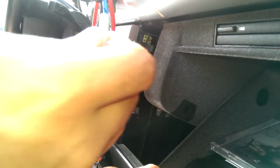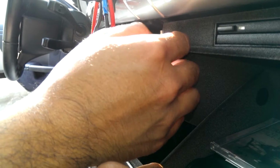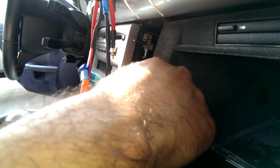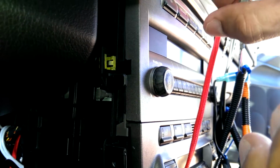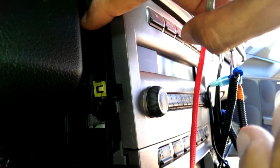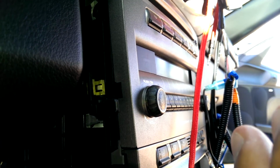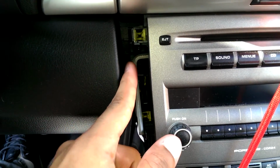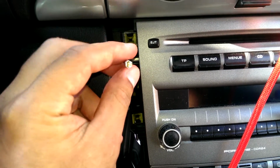the radio. Fasteners on the radio, they're simply 90 degrees, so don't turn them too far. They will snap. They're a little more difficult to see, but they're there, and up here, there it is. That one's definitely the toughest one. So get the Allen key in there and get your 90 degrees.